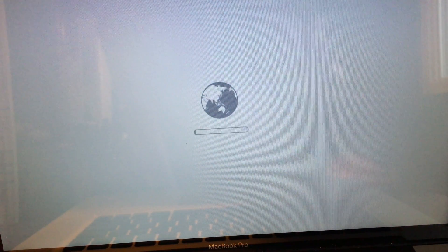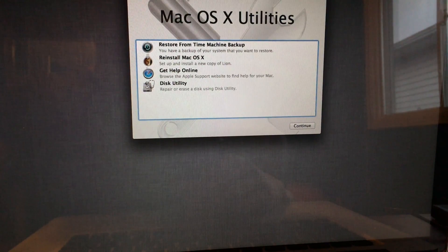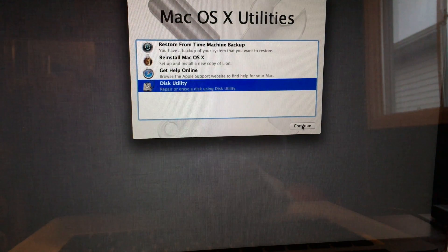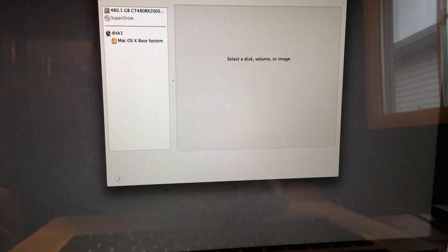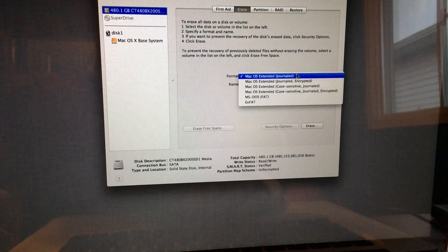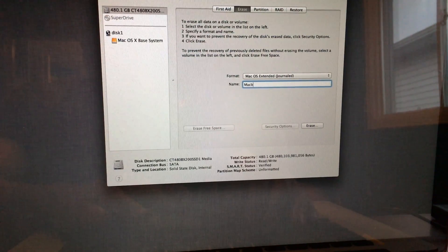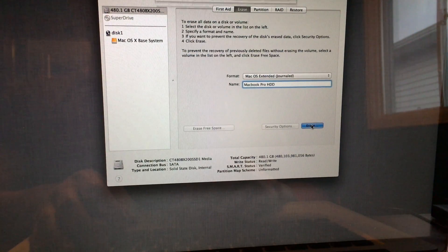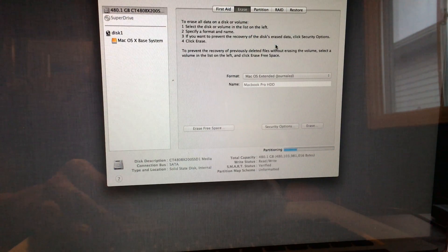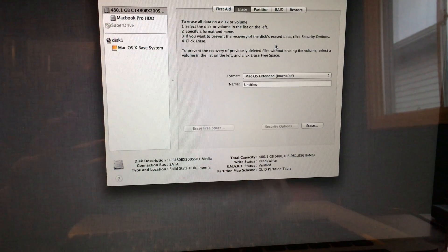After recovery, it went into this page. From here, go into Disk Utility, press Continue, and we're going to format our SSD. Here's our SSD — select it and hit Erase, choose Mac OS Extended (Journaled). You can name it right now; I'm naming mine 'MacBook Pro HDD.' Hit Erase, and this is actually really fast even for a large drive. Done — now close Disk Utility.